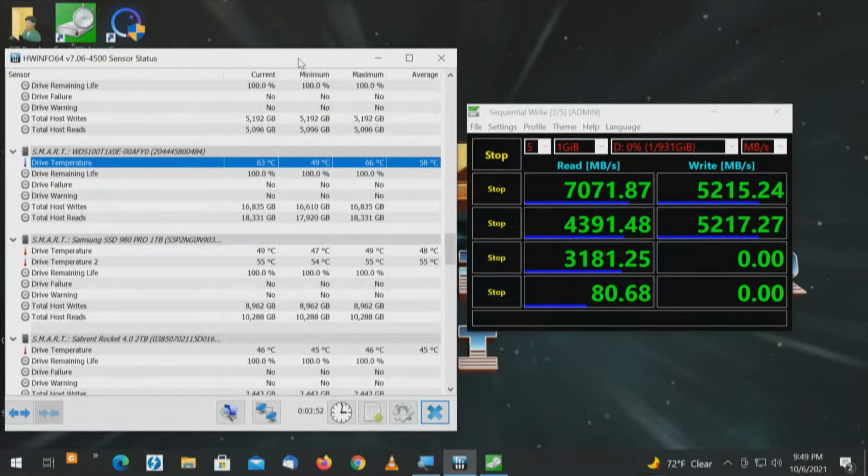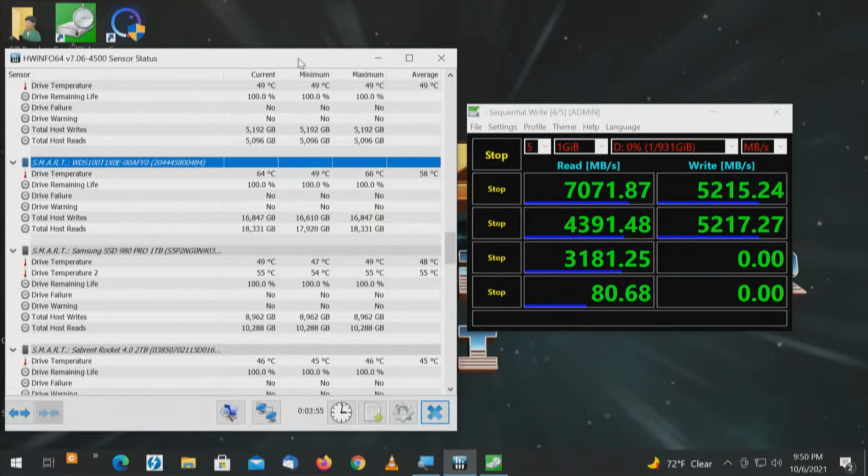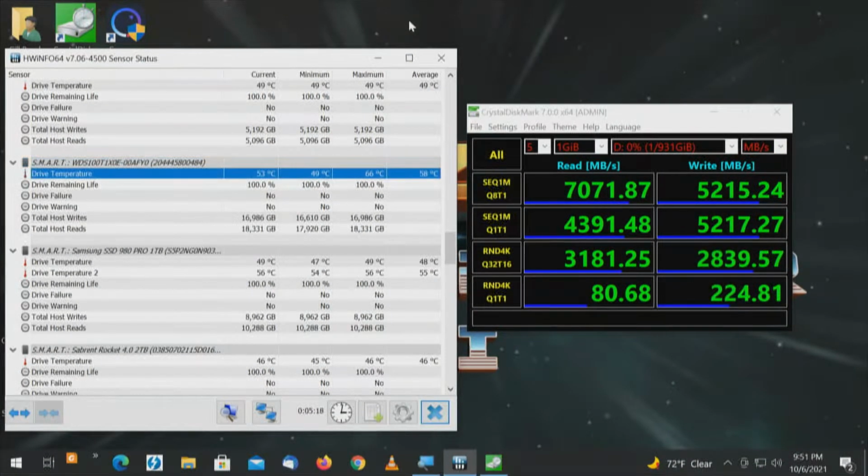In case anybody is wondering, the issue is really not with the Gigabyte Aorus card. There's something with the timing issue on the WD Black. It was just sensitive for the X570 chipset, and it's also apparently sensitive to the Gigabyte Aorus card. So if somebody asks, would I put 4 drives on that card, the WD Black, specifically SN850? Absolutely. But just test, verify, do the firmware, and power cycle it. Drain it. Okay, test is complete.